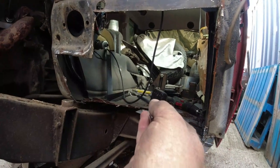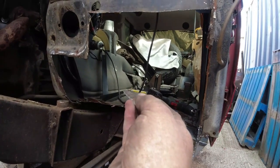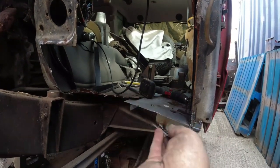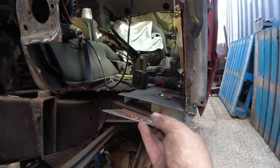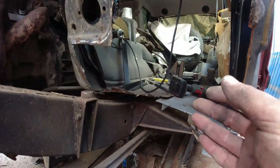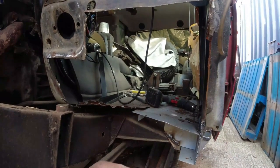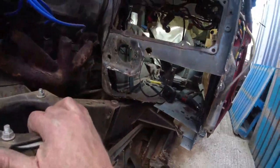What's left on here is largely rot-free around the edges, so if I can weld that piece in I think we'll be on to a winner. I'm going to spend the rest of the day getting this all lined up and fabricated so I know exactly how it goes together, then weld it in — and then apart from paint, the outer wing goes on, all the ancillaries, brakes and suspension, and we're kind of done on this side. Then get on with the other side.